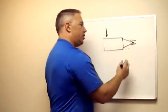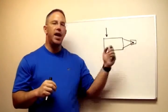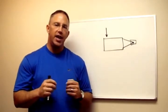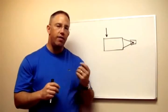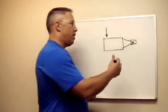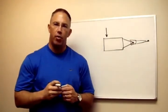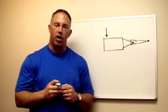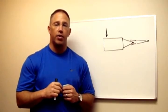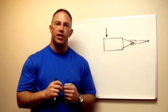A pivot point projection hitch operates completely differently. It is attached to the coupler of the trailer. By attaching the main head to the coupler of the trailer, we lock out the side to side movement on the hitch ball. Any side forces on the trailer that attempt to pivot the trailer at the coupler are actually projected forward — the trailer's effective pivot point is 52 inches forward of the ball. By locking out the side to side movement and projecting the pivot point forward to near the rear axle of your tow vehicle, the towed combination becomes very solid and very stable.